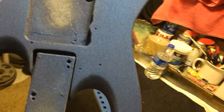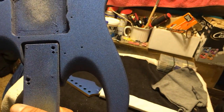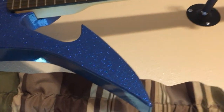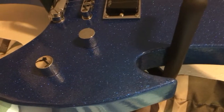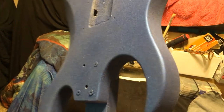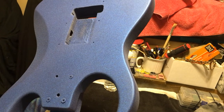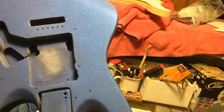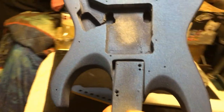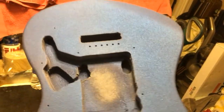I'm going to break out the old paint thinner and try to get all this off the body and start again. This sometimes happens - you think you've got the paint thing figured out. Even if I tried putting 2K clear coat over that, it wouldn't improve it at all. I attempted this blue glitter paint before with semi-okay results. This is not that. I have to make some hard decisions. Hopefully the paint thinner doesn't go through the primer coats, but it's going to be better than this. This is not acceptable. Let me move the operation outside and catch it before it cures really hard.